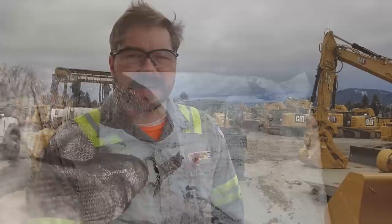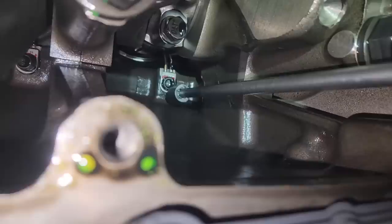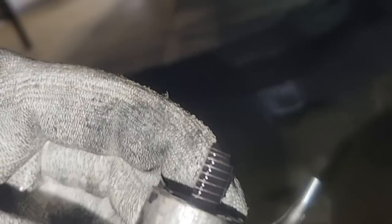Hey guys, so it's Tuesday — the second day on the job. We've got a couple of snow flurries going on. What we're going to try to do today is get the cylinder packs out and cut all the counterbores. Kind of a busy day. We've got our block strengthener, also known as the ladder plate, off. We've got the oil pump off. What do we do before pulling the cylinder packs? We need to pull our friends the piston cooling jets, also known as oilers. Leave these in and you risk destroying that engine — these are what keep the underside of the piston cool. You always want to inspect these after to make sure they're not damaged. The bolt looks weird but it's actually normal — it feeds oil around the bolt to the oiler. That's why it looks like that.